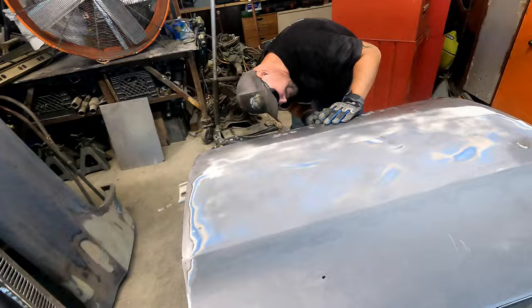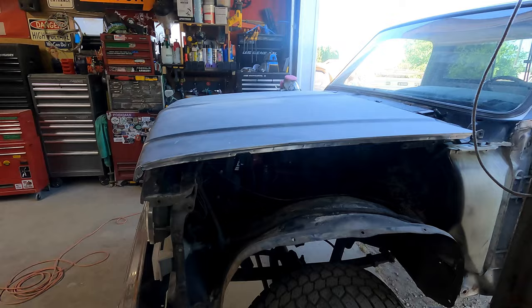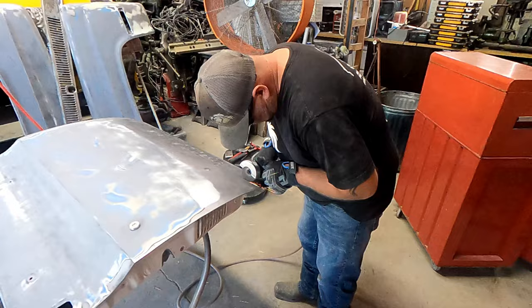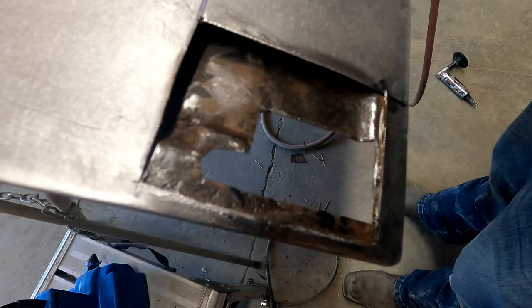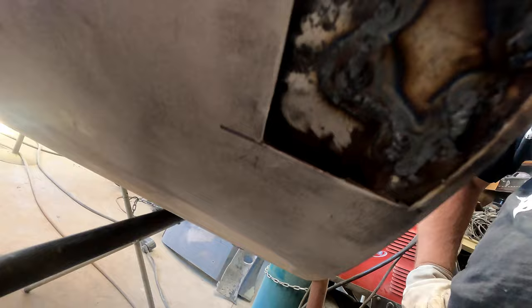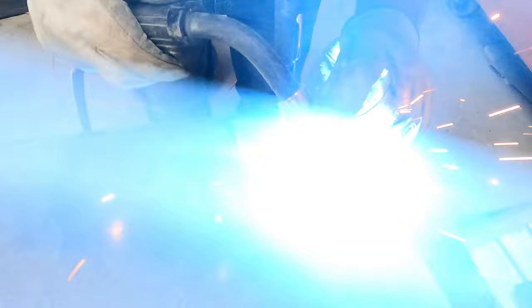A lot of people see an old piece of junk that's rusted out — we see the potential to return something to its glory. The amount of time it took to get this hood back to its original shape would make most people sick. With rust in every single corner, it's like cancer, so we take responsibility to remove it — cutting small sections around the rust spots for easy patch placement. Jason triple-checks his measurements so he only has to cut once. Now that the rust has been successfully removed we continue with fabrication, using electric shears to make easy work of cutting the patch. Through time and sweat it'll look like it was never even there. Now that the patch is in place it's time for Jason to do his welding magic.